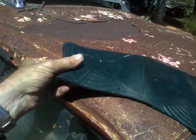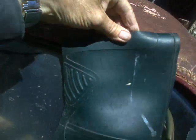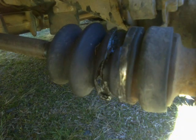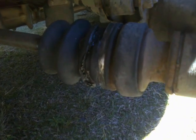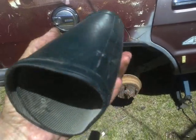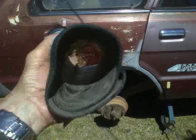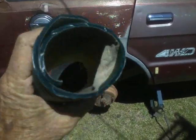First point: notice how dirty and dusty this is — if you look close you can see there's still a little bit of water drying out, because this thing has actually had a wash to get rid of all that dust, so that when the gorilla tape gets used it has a chance of sticking to the rubber instead of sticking to the dust. You'll note that this is not actually a flat rectangle — it's a segment out of a cone. I consider that a goodness, because that end is going to be larger in diameter than the fastening at the other end, so having a pre-fabricated conical patch is not a bad thing at all. My plan is to put it in position so that when driving forward, this edge is less likely to scoop up debris and feed it inside to the vital tender bits.